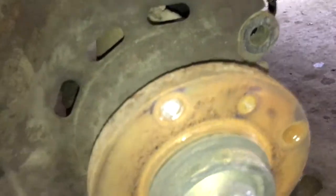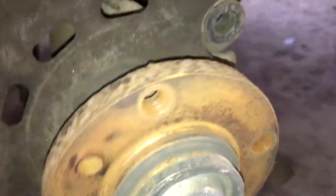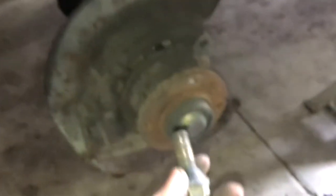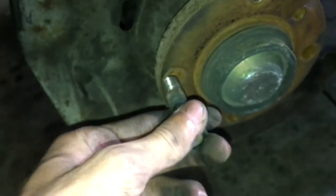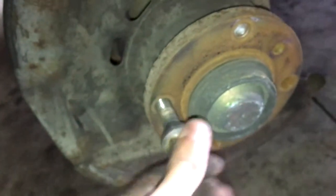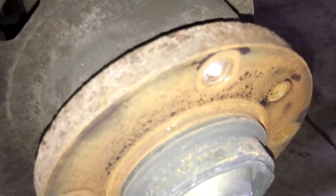This is what we're dealing with. This is the stuck one — it's in here. You can see all the other ones have nothing in them, because with BMWs they use lug bolts, not lug nuts, so there are no studs here. The wheel sits on the hub and then you put these in and thread them in. I don't know why BMW did that, but yeah, to get this out...